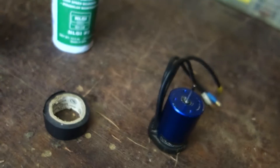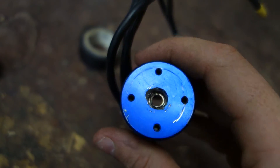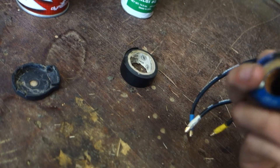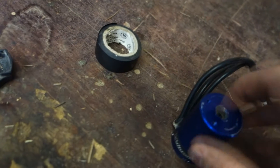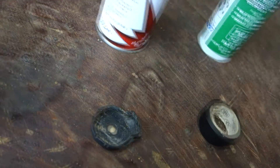After you get your motor all apart, you should just have the end bell and the rotor itself with a little bushing at the end. I do know this motor is really messed up — that was because I had a bearing go out. Right where my finger is, the coils are actually starting to come out a little bit. Anyway, this motor is one I would run in sand, mud, water, etc., so that's why I'm trying to make it last as long as possible.